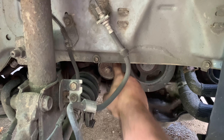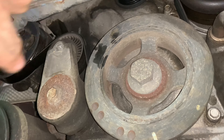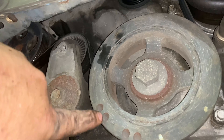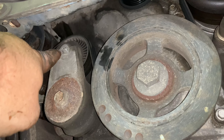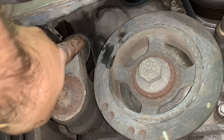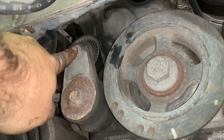As soon as you have these two hoses up out of the way, you will see down here — this is the alternator. You'll see right here there is a bolt, right here there is a bolt, and those two bolts should be 13 millimeters. There's also one back behind there which we can't see yet.